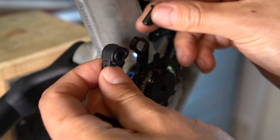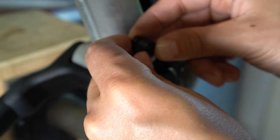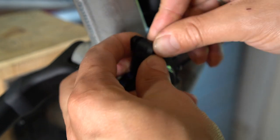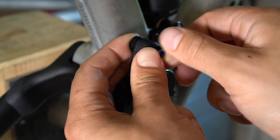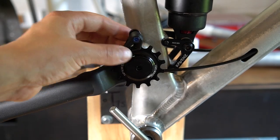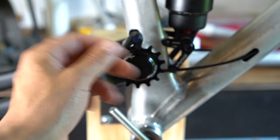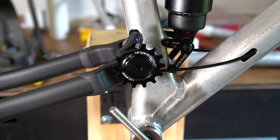easiest way is to get it set up like this, because you want to get it behind. So there you go. Let me just refocus a little bit. And there we go. Height looks perfect. Everything looks basically perfect. You can close that bolt with 2 to 3 Newton meters, just like the other ones. And it should make your chain stay there nice and tidy.